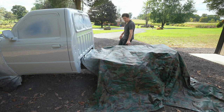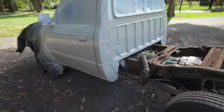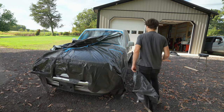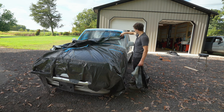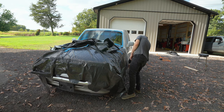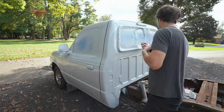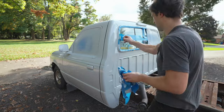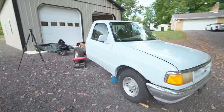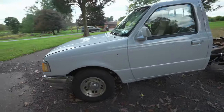It's kind of ironic — I made a video with tips about how to get a good paint job, and this was a questionable quality paint job. A few areas, if you look close, do have some runs right there. But you'd rather have runs in the clear coat than not have sprayed enough, because if you don't spray enough clear coat there's no correcting it. All the runs in the paint can be polished and buffed — I'm not gonna do that, but somebody should. Tip number twenty-one: don't wait too long to pull the tape off or else the clear coat edge will look pretty haggard.